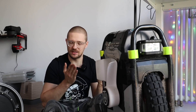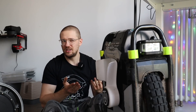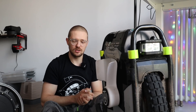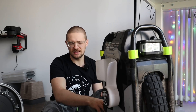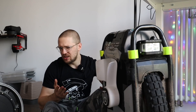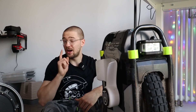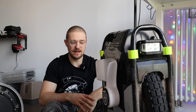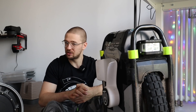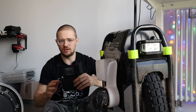In the meantime, I did locally repair the Sherman by changing the bearings to stainless steel ones and now it rides fine. I also didn't have any issues with the cover, even though I was riding in rain and snow. I also didn't have much trouble with tire alignment — it did slightly wobble side to side, but nothing major. So there aren't really any pressing issues for me to do this. However, I'm very curious how it rides with the wider rim and shorter L hangers, because scraping pedals and a poor turning radius at high speeds bothers me a little.